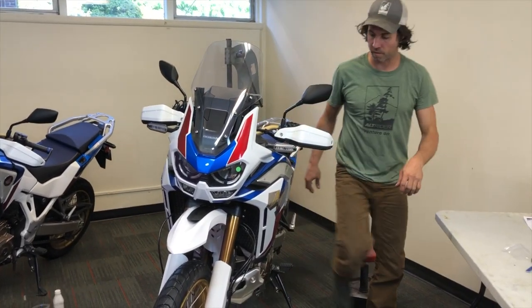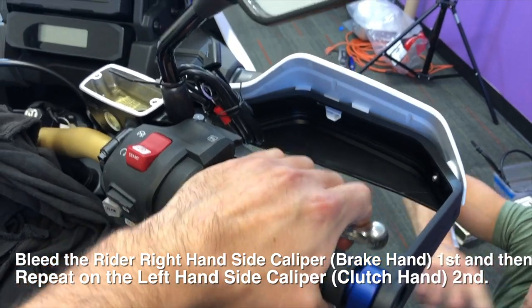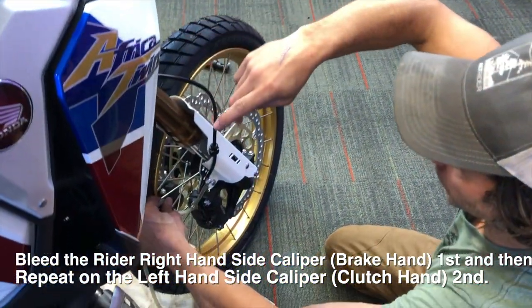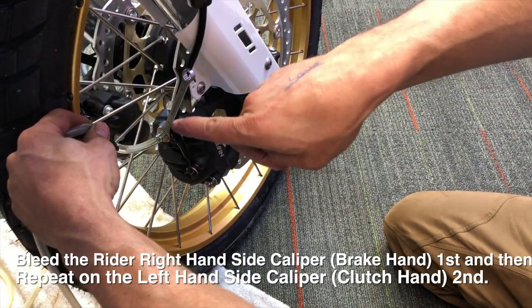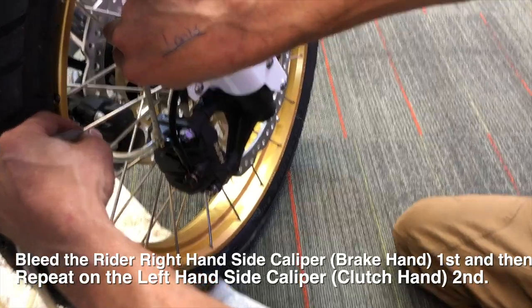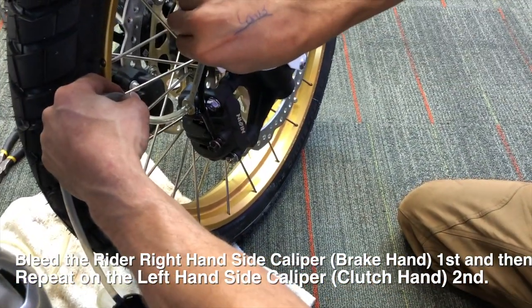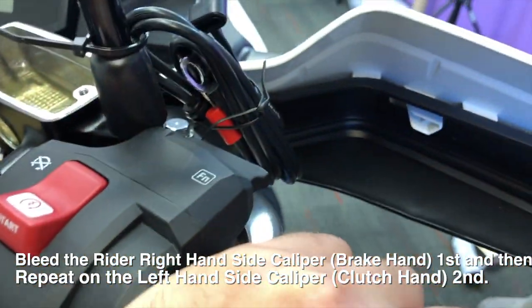Then I'm going to tighten up my front fork and finish our final bleed. Getting a helper is great — you can keep an eye on your master cylinder and the fluid level. Between pumps when you're opening the line, the helper can also slap out bubbles in that upper master cylinder, which is tremendously helpful to get the system clear. It's pretty simple: get yourself a hose that is the right diameter to fit on the nipple of the bleeder line. He's on full pull and then I just crack the line — you saw that bubble race by — and then I close it. He then repumps to build pressure again. We missed the first couple good ones and now he builds up and we do it one more time, keeping an eye on fluid, and then do the same on the other side.